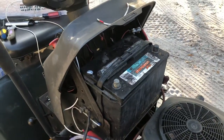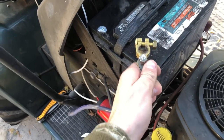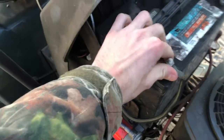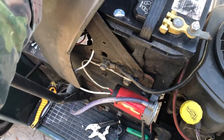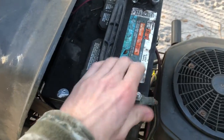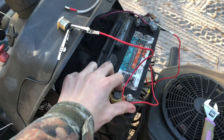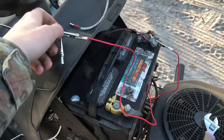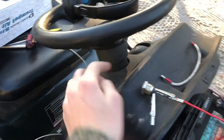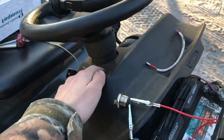I'm going to go ahead and slide the negative terminal back on and get it in place, then hit the button — wait, I need to tighten it down first. After a quick bypass test with my test leads it does work. Turns out my button went out — it doesn't work anymore. Even when I bypassed the fuse and went straight to the button it doesn't work. So I'm going to drill the hole out a little bigger and put a fresh new button in.